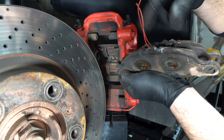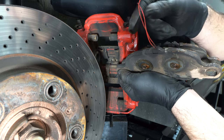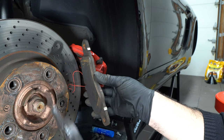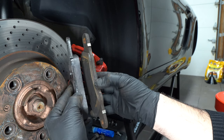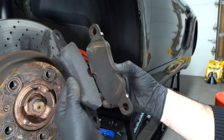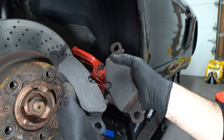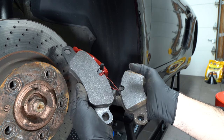If you actually care about the brake sensors, you can either pop them out and reuse them or get new ones — they're fairly affordable. As a comparison, these are the front stock pads I just removed and these are the track pads I'm putting on. They actually have a lot more meat left. From a design perspective they are very similar; there's no shim in the back but size-wise they are the same. They do not have glides on each side, so from experience these pads will squeak, but we're only going to be using them at the track.